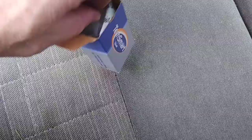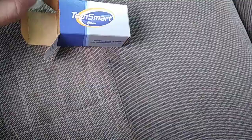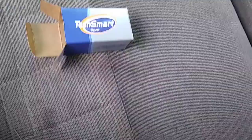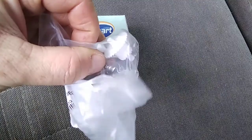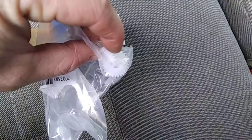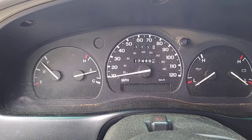It's been a while since I've torn this dash apart, so we're going to give it another try today. I also need to clean up my cluster. This is what it consists of: your worm gear and the drive gear. When these get brittle — normally the worm gear goes first, sometimes the drive gear too — they break and your odometer stops working. So today we're going to replace that.